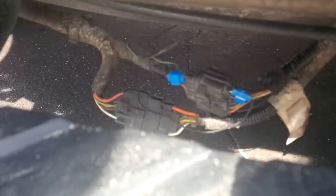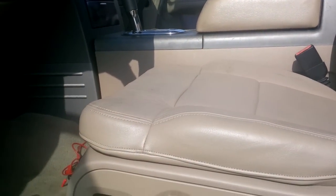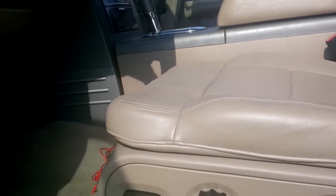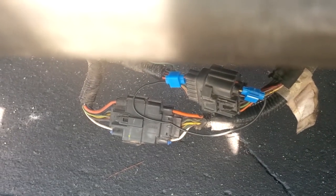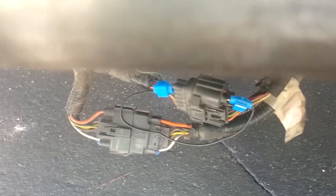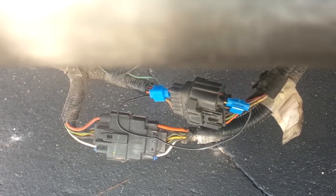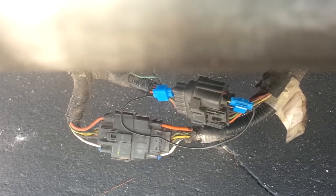Well, Ford really did us all a great favor. Right down here, underneath the truck, basically underneath the driver's seat. We do sell leathers and we do sell seat pads, if you need those, give us a call. But right underneath all that, you'll see there's 2 Scotch crimps and a wire. That orange wire right there is the ground circuit for the return on the PCM and the fuel pump.